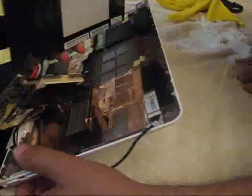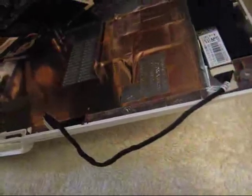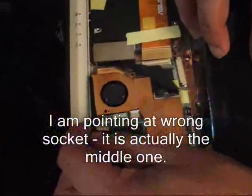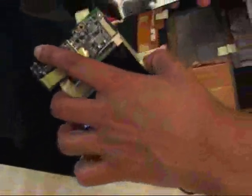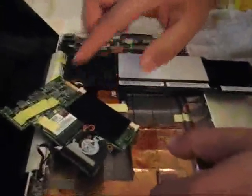Once you do that, there is a black plastic membrane, and beneath that there will be the RAM. We need to disconnect that. Now because we did not remove this cable, you can't freely open this. So we figured out we need to remove this cable — you unplug that cable, then it just freely comes out and you can rotate the board like this and keep it this way. I just need to remove this black cover and there will be the RAM beneath that.